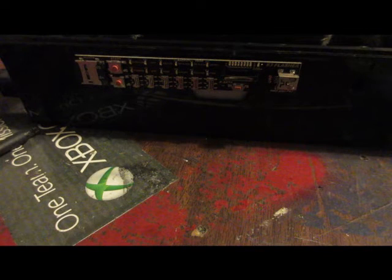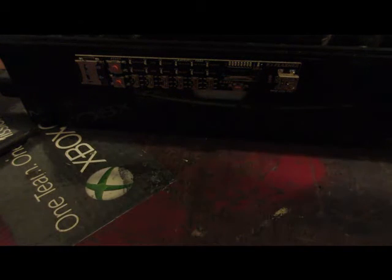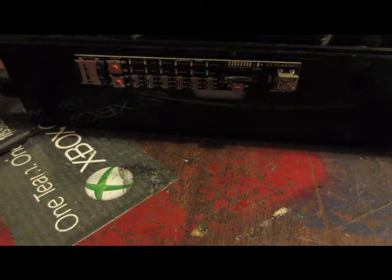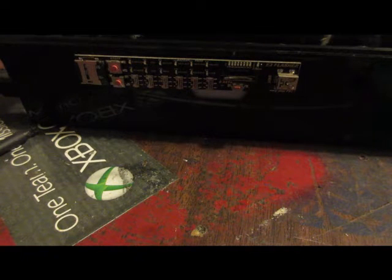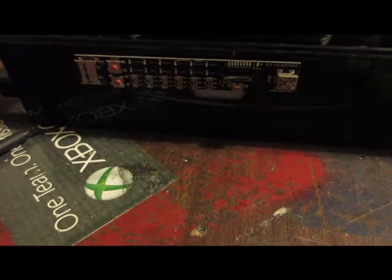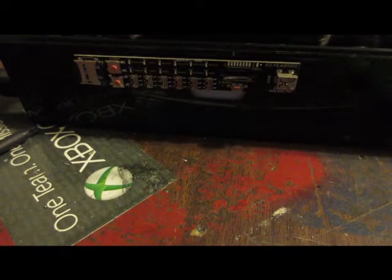All right, so what we have here today, the E3 flasher downgrade. It's pretty straightforward. Just make sure that, if you're doing it the solderless way with the clip, you can't really see it, but on yours, when you first open it out of the box, there's going to be a little half a step here. It's going to look like the top step, then a middle step, and then the bottom step. We want to get rid of that middle step altogether.